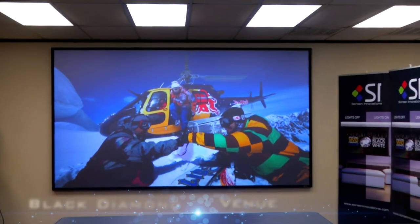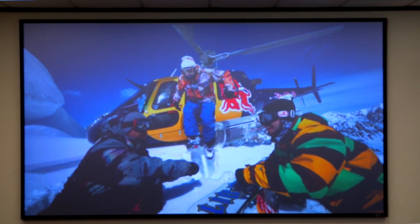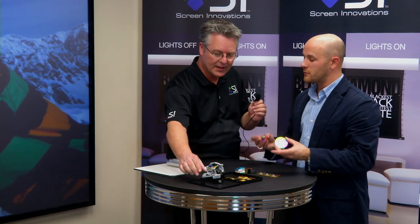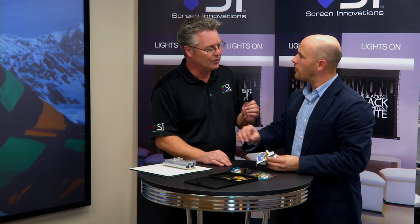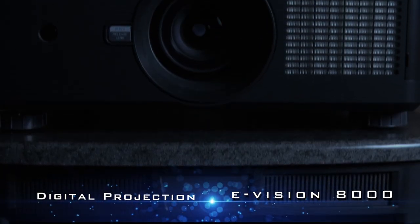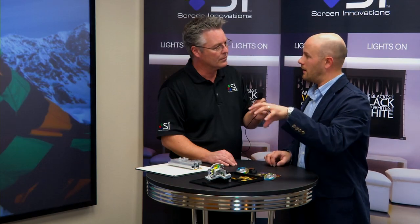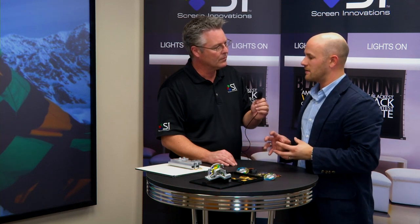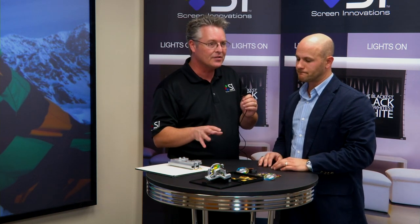If your content is PowerPoint, white documents, Excel spreadsheets, Word — something like that — it's a fantastic application; you're getting something very bright. What's truly unique about the E-Vision is the ability to switch between these two color wheels, and that's this little guy right here. It's just like changing a lamp in a projector — you open up the door, undo the Phillips head screw, take out the current color wheel, put the other one in, and just like that you've completely changed the projector. You've gone from a projector great for an ambient-lit situation — like a house of worship, boardroom, or living room — to a color-saturated color wheel that makes it perfectly usable for a light-controlled environment like a theater, or an advertising agency that wants to turn lights off and see high-def content in detail. That versatility is very unique to this product.